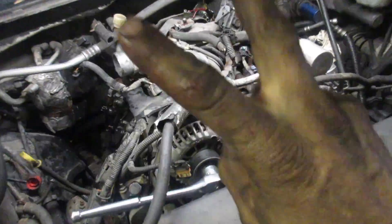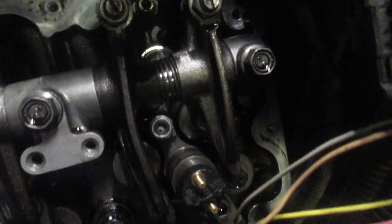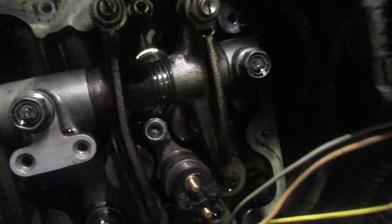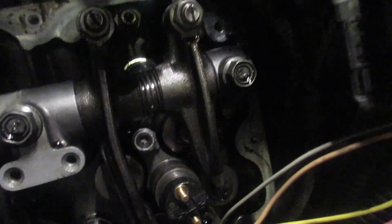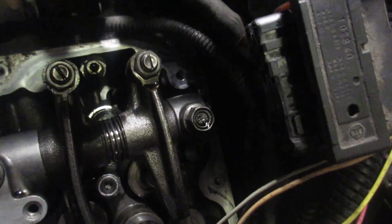You can set this engine in two spots. When I say valves are rocking, I mean that the intake and the exhaust are between the two strokes. You can see the intake going there. I'm turning the engine backwards until the intake will go up and the exhaust will go down. As soon as you see that exhaust moving, you know you're at top dead center.